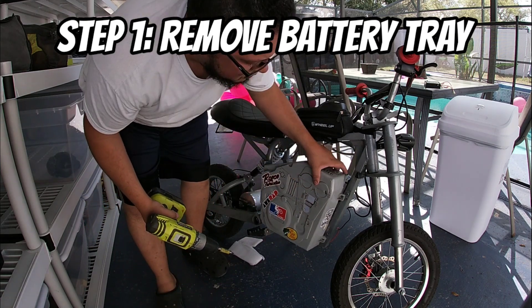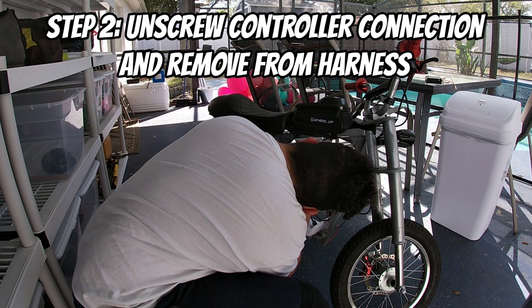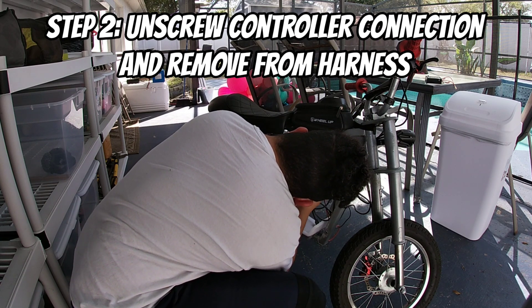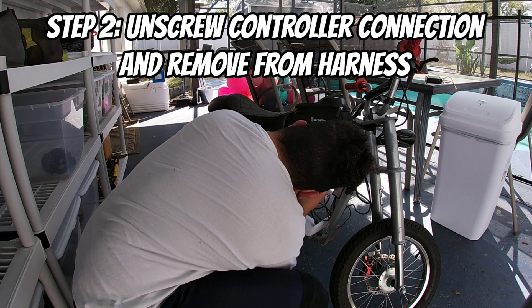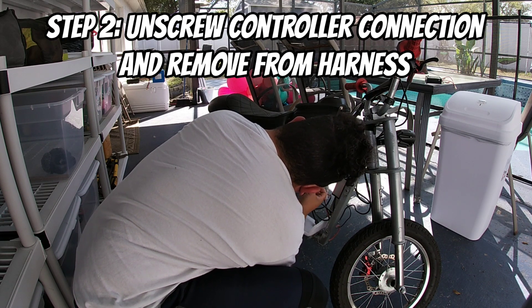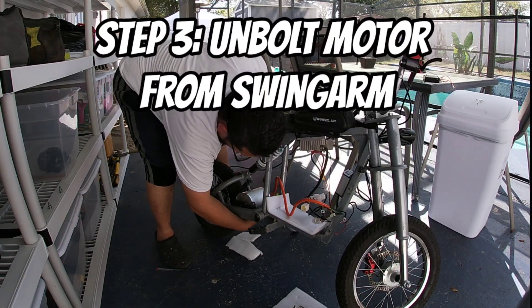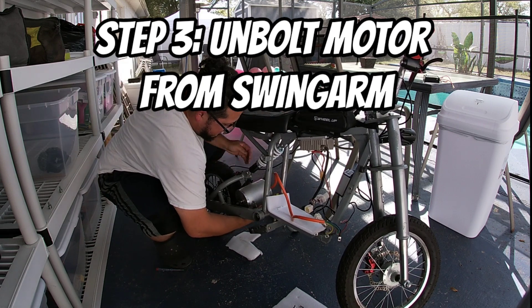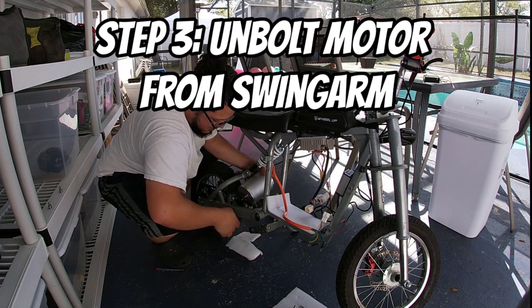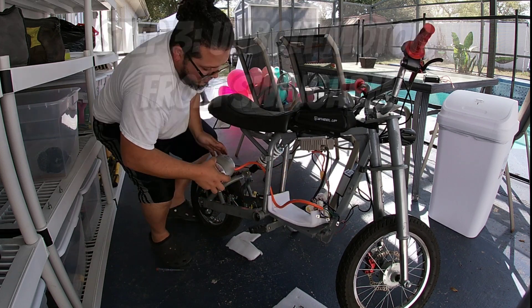Make sure you give this a thumbs up. Quick tip here guys: when removing the motor from the swing arm, make sure you put something protective on the ground — whether it's a piece of foam, a towel, or a piece of cardboard. Just make sure you have something underneath the motor so that if it slips out of your hands, it doesn't fall to the ground, get banged up, or damage the sprockets.